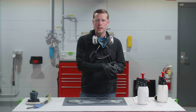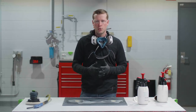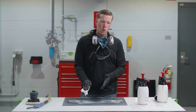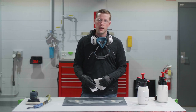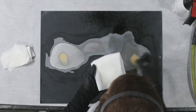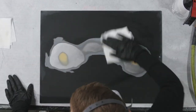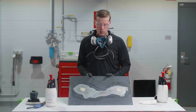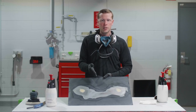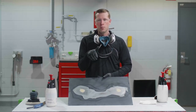With body filler and glazes, we want to avoid applying the solvent-based cleaner directly to the filler or glaze, as it can absorb the material and lead to issues down the road. The solution is to apply the cleaner directly to a paper towel, wipe the surface with the saturated paper towel, then use a secondary paper towel to wipe until completely dry. We also don't recommend a water-based cleaner here, as we don't want to introduce moisture that could lead to flash rusting on bare steel or permeate into the body filler itself.